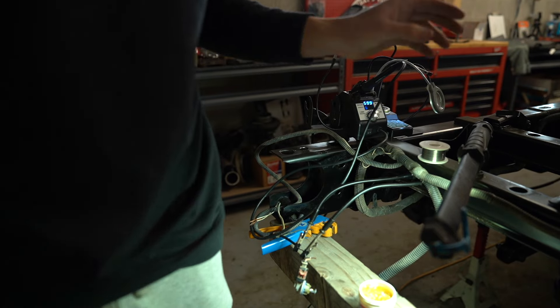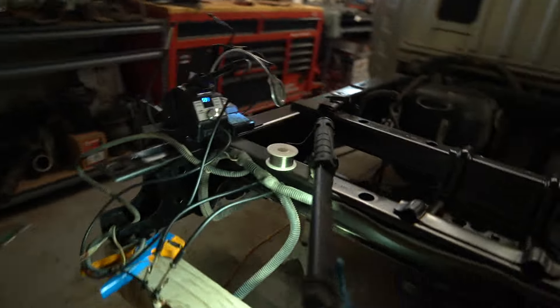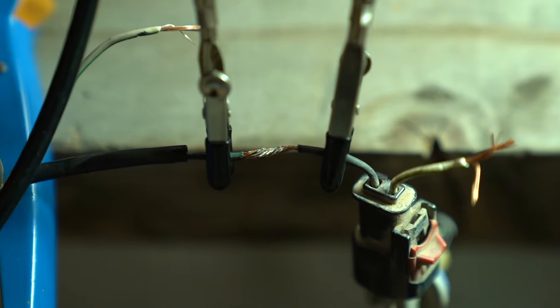It takes a minute to get your copper warmed up, but once you warm it up from the bottom, that's what you get. Set it up properly from the get-go — provide heat from the bottom, solder in from the top, and it'll flow through and close up the gap. Now we've got to do all the connections on the driver's side and passenger's side tail lights. I'll get the butt connectors — I probably wouldn't have cut these all out had they been done properly, but this is just peace of mind.